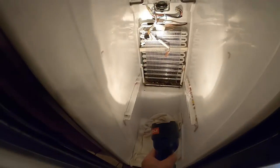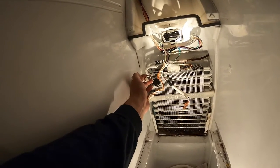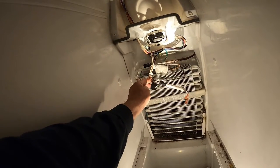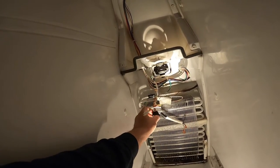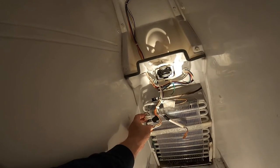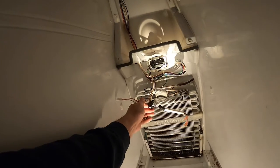Here's what I'm going to do: I'll put direct 120 volts on this heating element, and if that heating element works, then it narrows it down to this little thermostat. The measurements from the orange to white wires — I'm leaning towards it being this thermostat, even though there's no physical evidence of it being broken. I'm going to put power to the element to see if it heats up, and also put power to the thermostat to see if I can hear any switching like a solenoid. I'm almost 99% sure it's this right now.